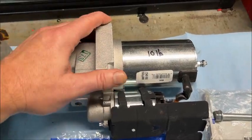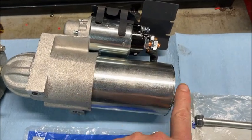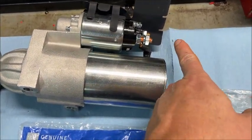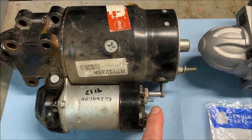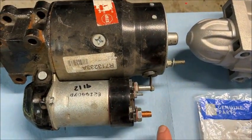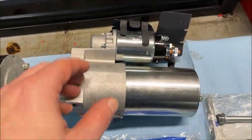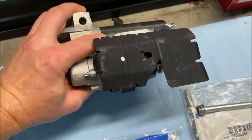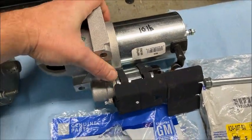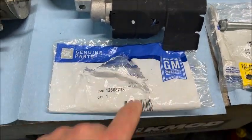The new style solenoids are also shorter, so it's quite a bit away from the end. My exhaust manifold should come down right here, so it's going to be far away from this unit. Whereas with the old one, the exhaust manifold comes through right here and the solenoid is very close. Those two things together — the smaller size and the shorter solenoid — should cure the hot start problem. Another thing I did is I bought a heat shield.